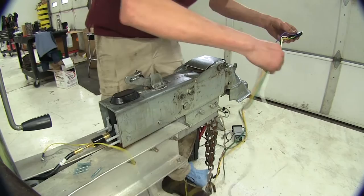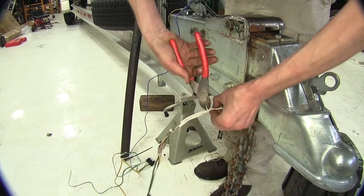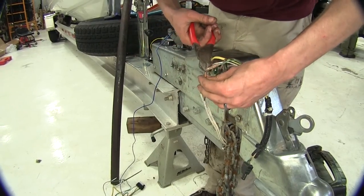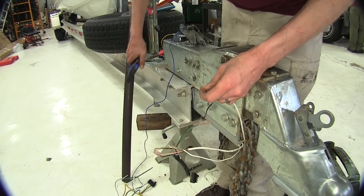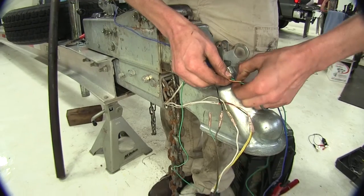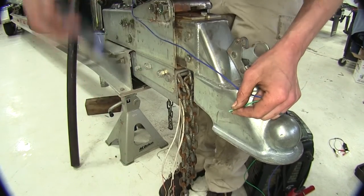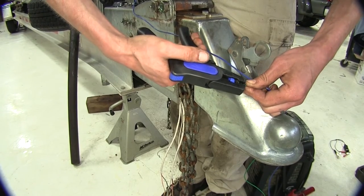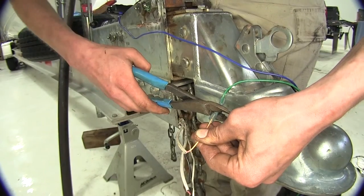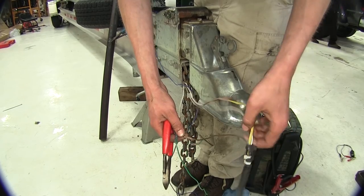We can hook up the rest of our wires to where they go based on our connection. I'm going to take our old connection and cut off the zip ties to separate our wires so we can access them more easily. Starting with the green wire, we'll strip back about a quarter of an inch, measure off where we need to trim, cut the excess, and install our butt connectors. Then we'll take the brown wire for our right side and do that one next, repeating the same process for the other wires.